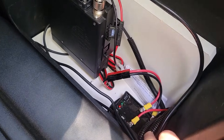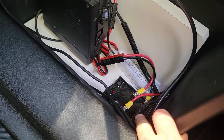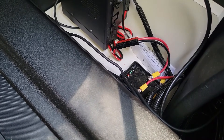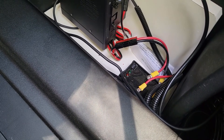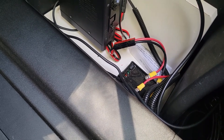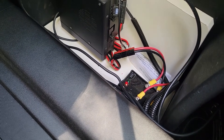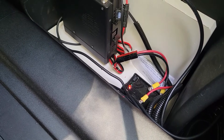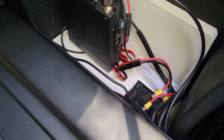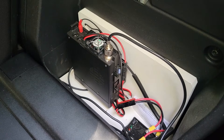And this here is a great addition — a relay that goes to the battery. After about 15 minutes, it will cut off power to the radio, so I can use the radio for 15 minutes after the truck is off, and that way I don't run the battery down. If I want to go longer, I just have to turn the truck on for another few minutes. This prevents me from running the battery down, which is imperative. In this setup, I don't have a secondary battery under the hood yet.